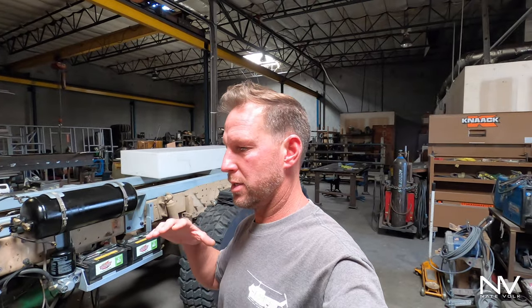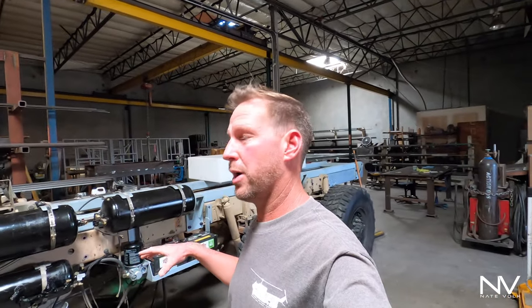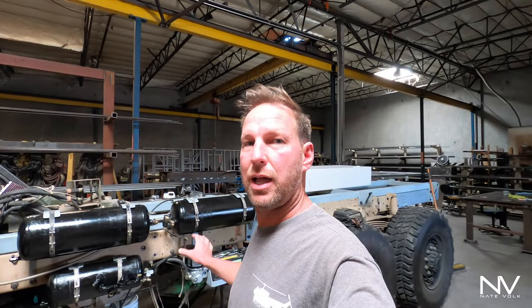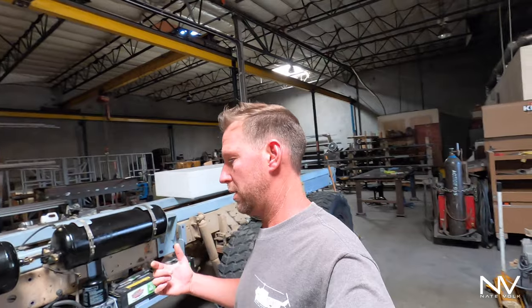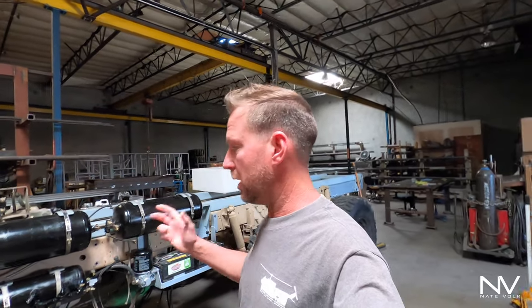I'll link to a couple things in the description. This air dryer was like 65 bucks and it replaces the old big air dryer that's like 180 to rebuild. The cartridges for this air dryer are like 12 bucks, you can get them at NAPA — they just spin on, replace them like once a year or maybe every two years with these trucks. I wasn't sure about the fittings but got all that sorted out. There was only one adapter I needed for the governor line — a three-eighths NPT to quarter NPT. The airline is three-eighths, the new air dryer is quarter NPT.